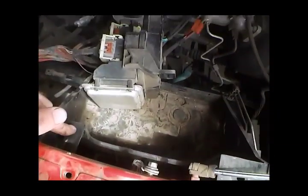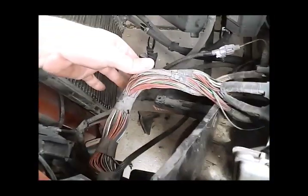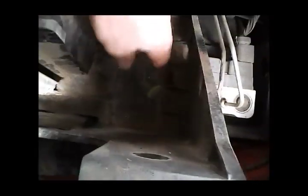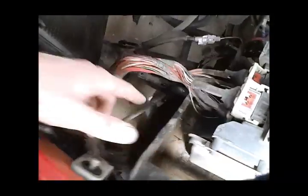I took the battery out, took this bracket off. This bolt here attaches to here and those pins slide on these grooves. So once you loosen that bolt, you just sort of pop it forward, and you're able to move this out of the way nicely. Be careful not to hit these wires. The battery box just sort of falls down. You have to be careful because the ABS module is right here — I did remove the bolt just so it has some play, but you don't want to bend these lines because you could possibly break them.